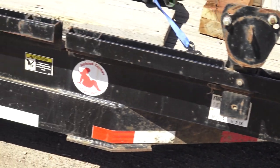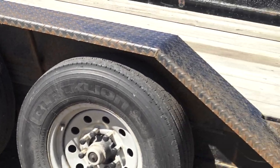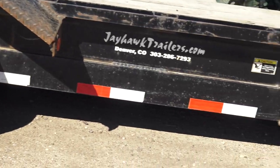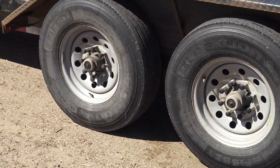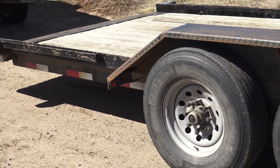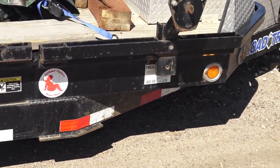The trailer we're using is a Load Trail tilt car trailer, 22 feet long, weighs between 4,500 and 4,600 pounds. The axles are fairly forward on this with torsion axles so it's low to the ground — it's actually double framed. This is a little harder to hook up than an RV trailer, which has the trailer hitch higher in the air with lots of room for your spring arms adjustment to get to 32 inches. This one is lower to the ground.